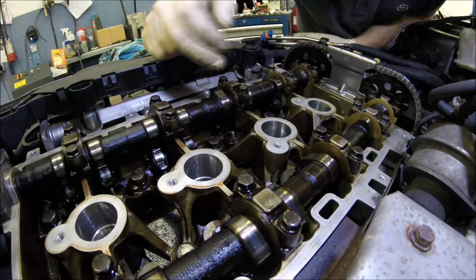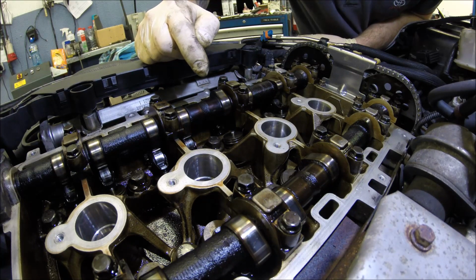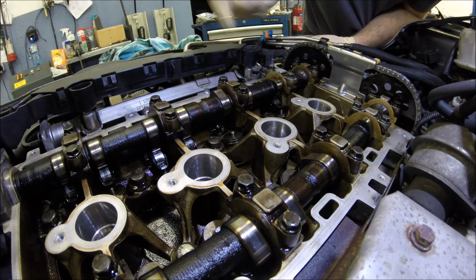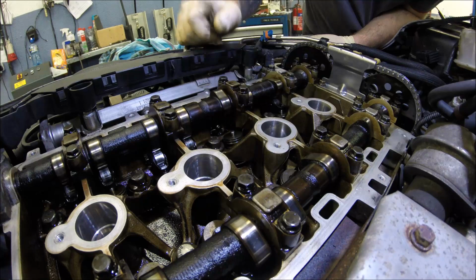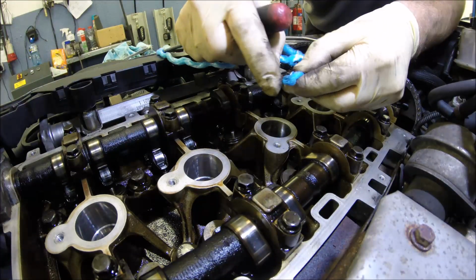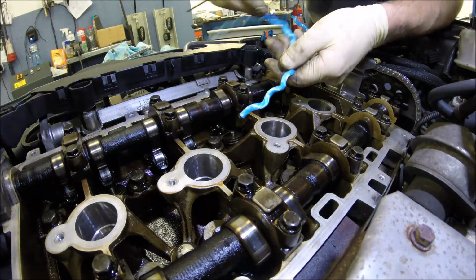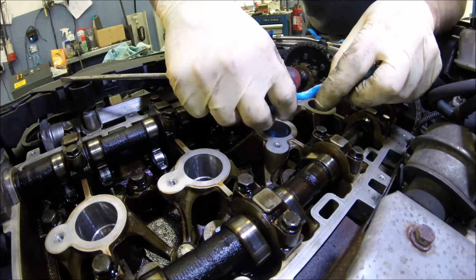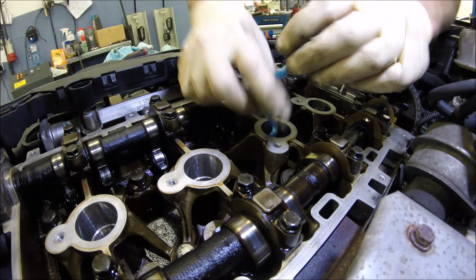Okay, if the two rockers are out, now we have to put something in the cylinder and turn back, which squashes the rope inside, and that will not damage anything and will catch the valve. Okay, so we have the rope like that. It's only for safety, nothing should go wrong. It's soft, and we push on the piston now. How much is possible?